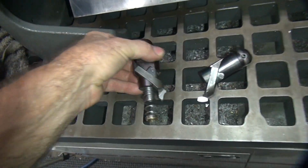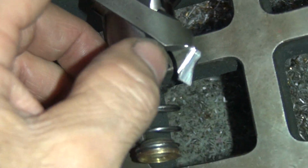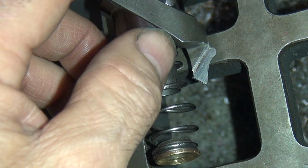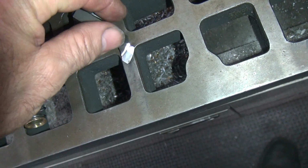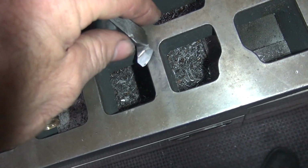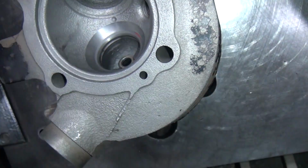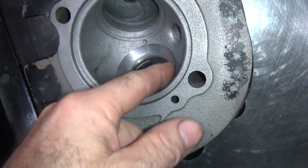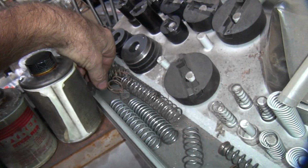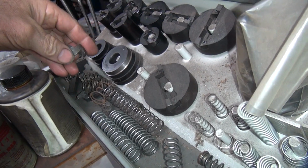These are our two cutters we're using. This one here cuts the seats. See all the different angles that are on there, quite a few. And this here is my upper cut. It's got a parabolic curve on it that cuts the chamber cut in here. It doesn't put that big gouge in there like everybody else does. They just use a straight radius cutter, which I can't stand. That's what everybody uses because that's what they make. That's why I made my own stuff.